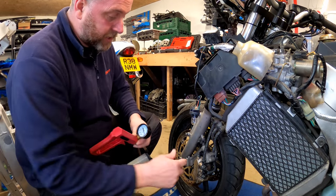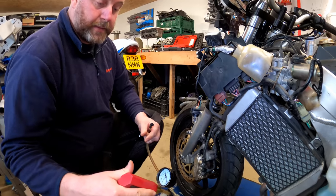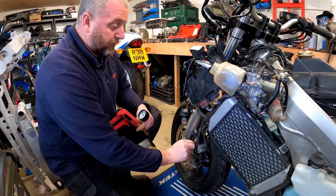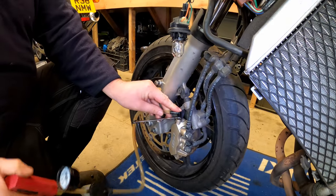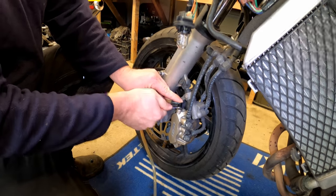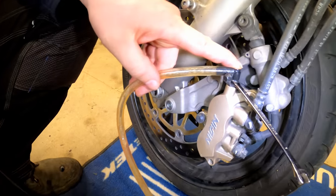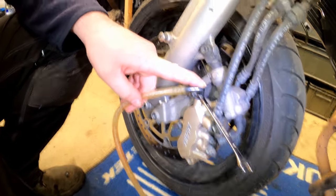Okay, what we're going to do is quickly suck the fluid out of all the bleed nipples. I'm going to do it in a particular order, and I'm going to be using a vacuum pump, which we've all seen plenty of times, so I'm not going to labour the point. I'll leave the link to this tool in the description if you want to go and get one for yourself. They're pretty cheap and they're worth every penny. So quick spanner on there, put the hose over the nipple, build up the vacuum, and then crack off the nipple, and then all I've got to do is maintain the vacuum, and you can see the fluid coming out, and it'll be captured in this little tub, and I'll just keep going across each of the bleed nipples until no more fluid comes out.